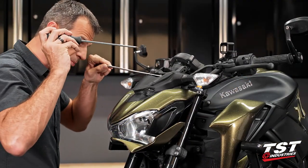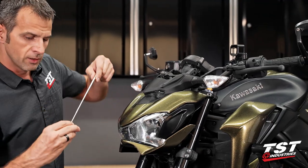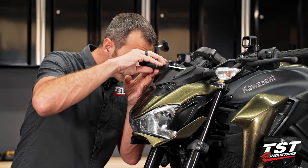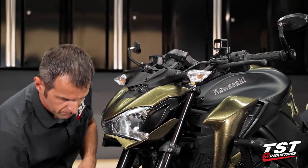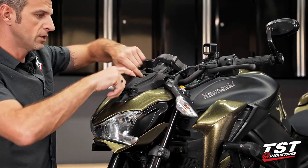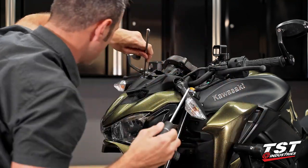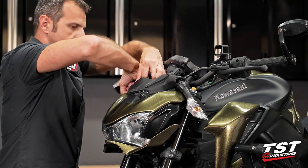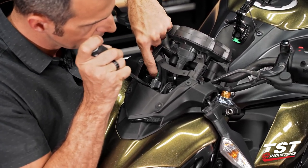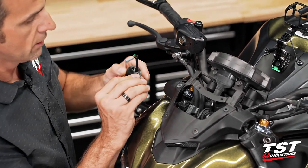I like to use a magnet in there so that I don't drop a screw inside my motorcycle. I've taken out the screw and the retaining bracket all in one shot. Now I can pop out the jamming bracket, grasp and turn, and now this is free. I will need to unplug it from the main plug here. To release the connector, press down on this locking feature on the mating plug, and that comes out pretty simply. Just make sure you get this assembly out with the inner jamming bracket. Repeat the procedure on the other side.